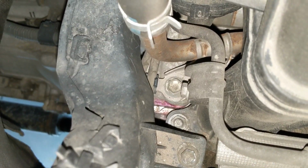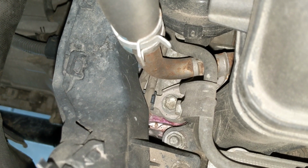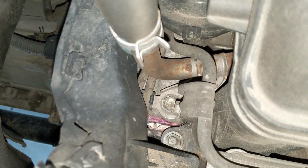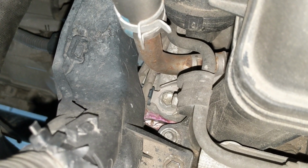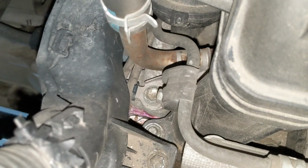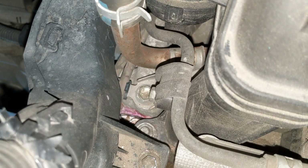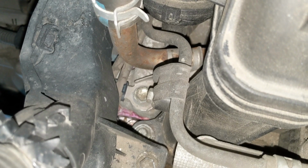There is a coolant union right there, and there's a metal gasket with an O-ring sort of inset in that metal plate. Found somebody online with a good video of it. I think that's what's leaking. There's fresh fluid right on that edge. So that is really good news if that's it. That's about 1,000 times better than a blown head gasket. So I think that's our problem.